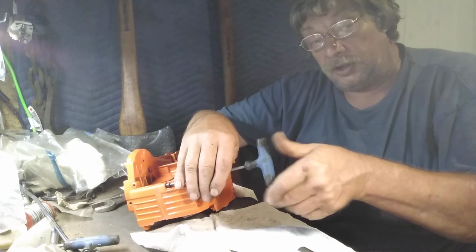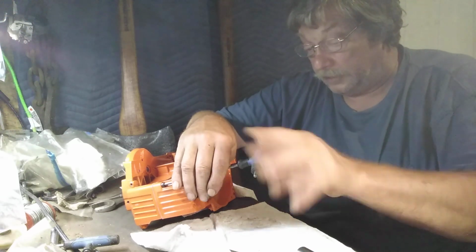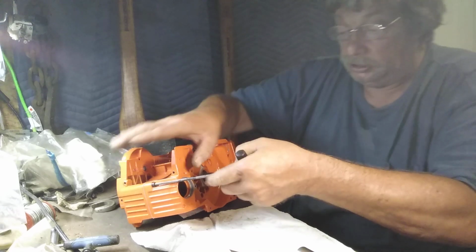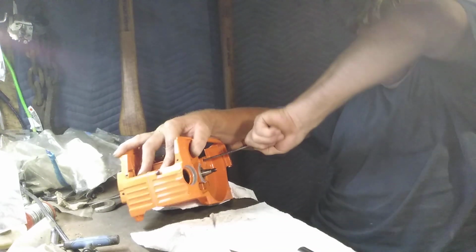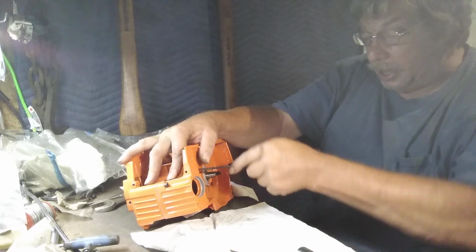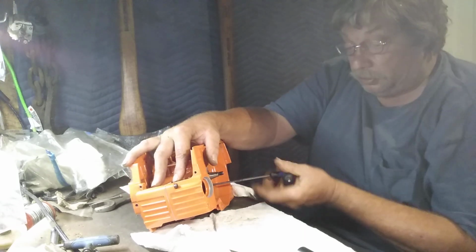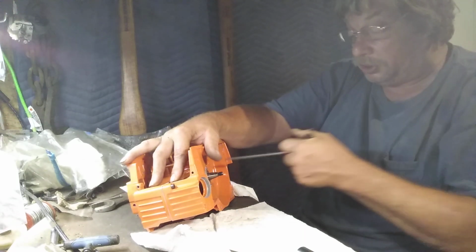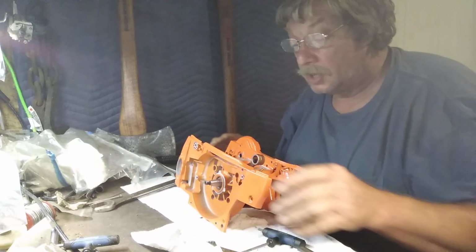I'm going to try to keep this video short so we can get it up. But there's one more thing after I get these case bolts tight that I want you to know. I'll actually go back in about another hour or two and I'll just feel these, make sure they're right, because you got no second chance on them. Okay, here's your deal, guys.